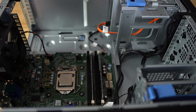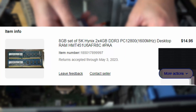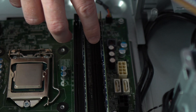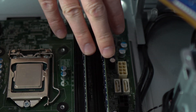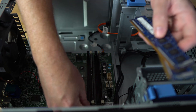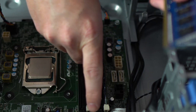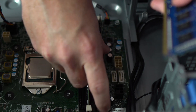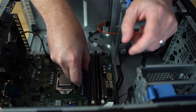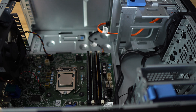While the PC is laid over, let's get some extra RAM installed. We picked up an 8GB kit from eBay for about $20 to populate the remaining slots and give us a total of 16GB of RAM — that'll be good for our gaming use case. Opening the retention arms and installing them one by one, and we're done with the RAM.